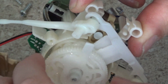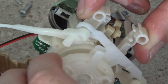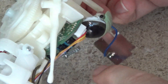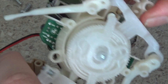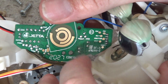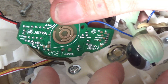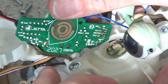Now my question is — this thing moves a complete 360 degrees and can never stop moving, so how do they know what position it's in? I wondered if they had some kind of optical sensor on the back side of the circuit board. I was wrong again — it's not an optical sensor. They have these little contact pads, and there's the part attached to the main cog that makes contact with the circuit board. That's how they're keeping track of what position the motor is in.